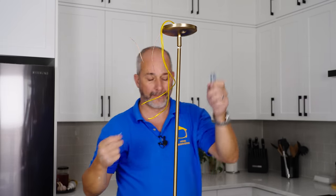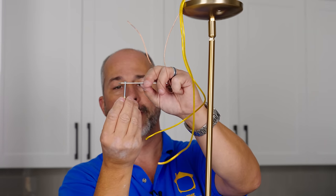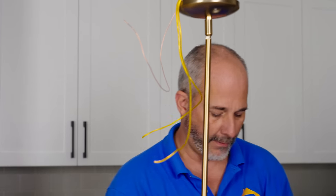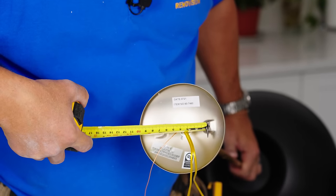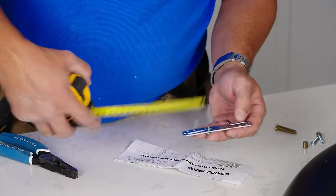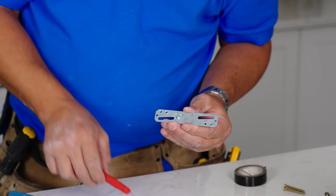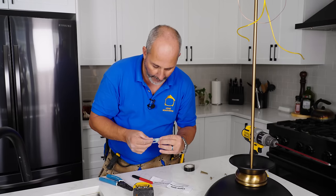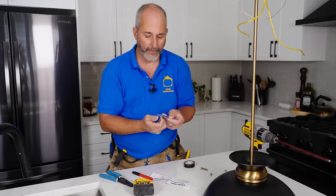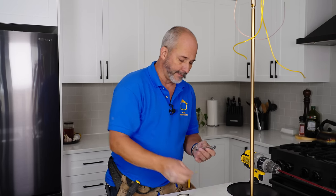The trouble is, if you use the long slot positions and then go to put your nut on, there's no resistance. So take your tape and measure hole to hole — in this case it's two and three quarters inches. These plates come universal, so find the two holes that are two and three quarters apart — in this case it's the interior lines. Thread the screw from the top down through the plate so that when you tighten it there's resistance and you can actually mount it. Start all the way in, and if it's still a little loose you can adjust the threads deeper to get the desired height.